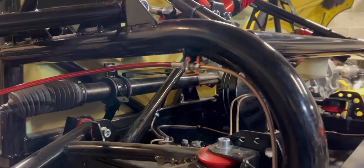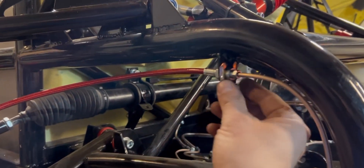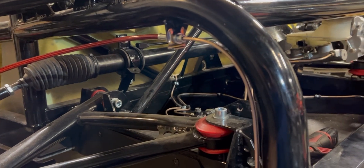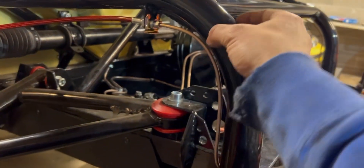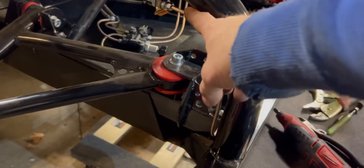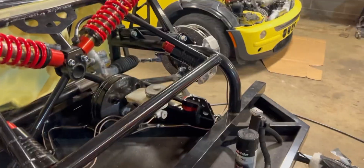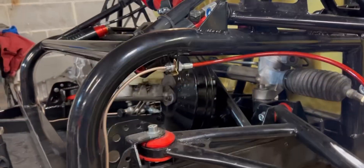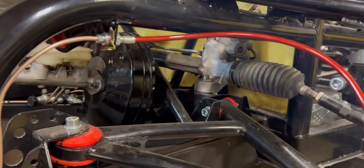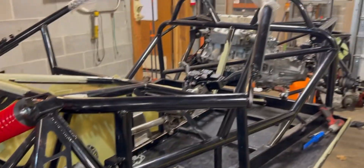This side is all done — threw some black paint on there. Even though this clip is technically supposed to go the other way, it only really fits this way otherwise it's really loose, so it is what it is. Unfortunately I did have to re-bend a new line because I messed this one up while welding — slag sticks to this stuff really easily, note to self don't do that. I re-bent and re-flared it. Got the driver's side done too — I remembered to take the line out so I didn't have to replace that. I also cut off some little plastic holder things I ended up not needing.